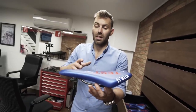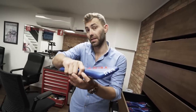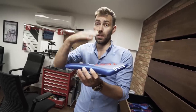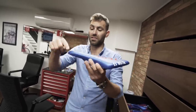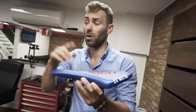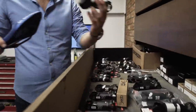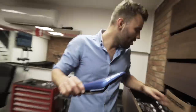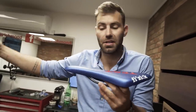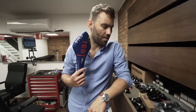I wouldn't say there's a right or wrong, but what I've come to find is that a rider will gravitate to the nose of the saddle as a result of either the saddle height being too high — because the nose is close to the bottom bracket — or, increasingly, excessive reach. We tend to fit stems that resemble a baby's forearm, and that results in the rider being excessively stretched out, causing them to sit on the nose of the saddle.